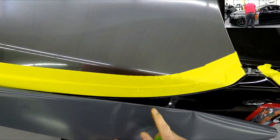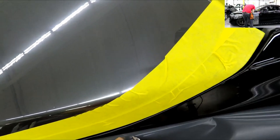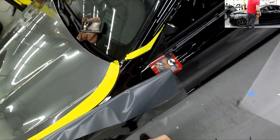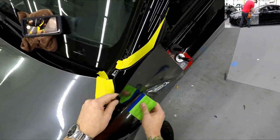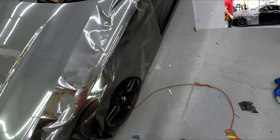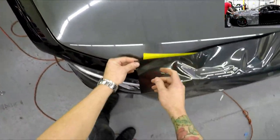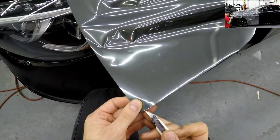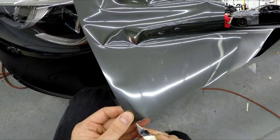Doing this alone is very difficult. We're at the edge — I can go up to about there. Now I need to stretch the vinyl across slightly to get rid of some of the slack. The cap will have to come off. Removing it is not the easiest — if you can find an edge that's separating slightly, sometimes it works. Even when you find a spot, it's still very difficult to peel.